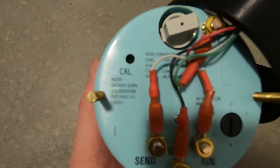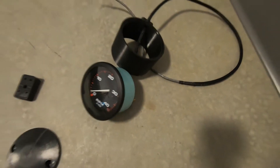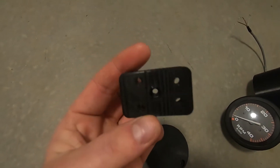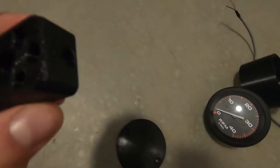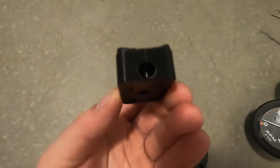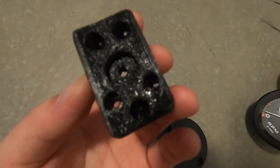Next, let's talk about the housing. I designed and 3D printed the housing for this tach. Starting with the base, you can see we've got four counter-bored screw holes to mount the base to the dash, as well as a large locating recess which is going to help keep everything square. Here we've got a conduit to allow the wiring to exit smoothly.